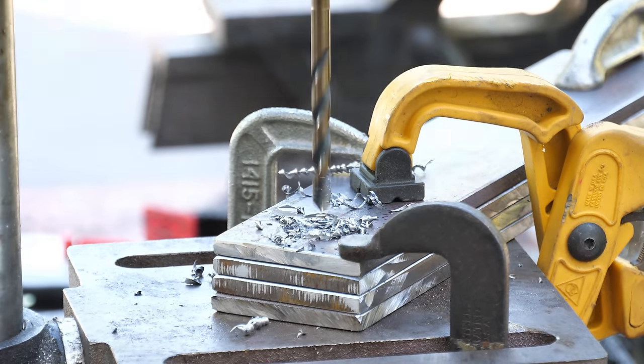as the exhaust. When the small block engine came out of the car, we removed everything in front of the mufflers, and I was hoping to reuse the intermediate pipes, although we will have to make them a bit shorter since the big block headers are a bit longer. I think we'll be able to get away with just trimming the side that goes into the muffler, and after a quick test fit, we'll cut about an inch off and see how that looks.